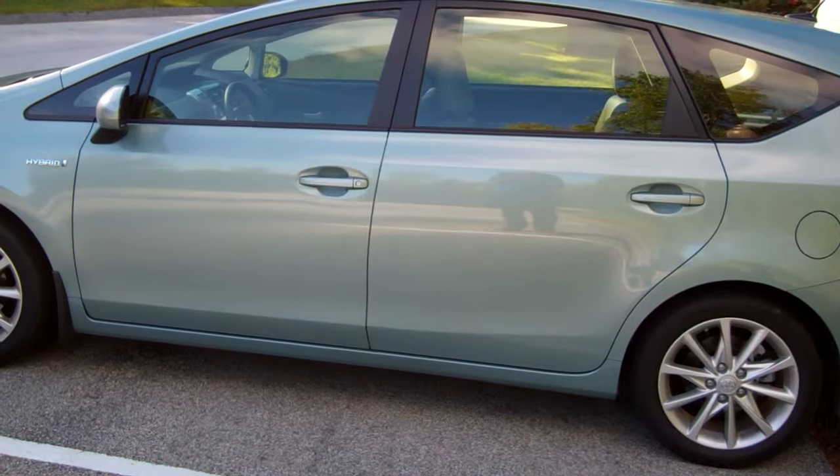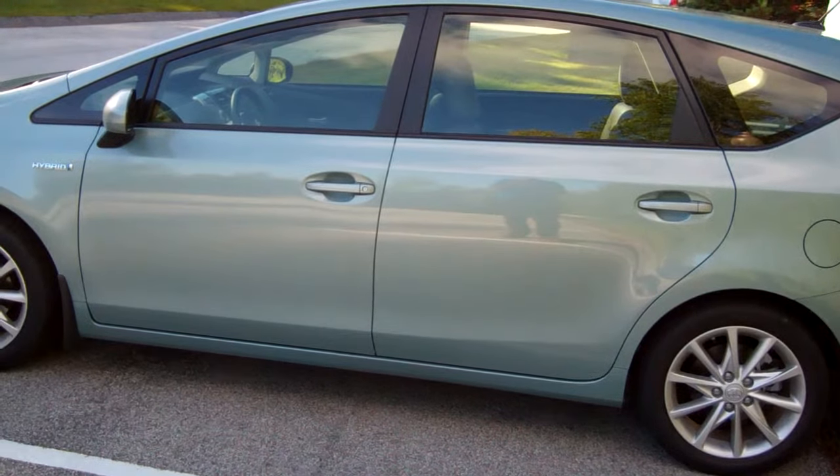Also, the inboard rear plastic cover does not fit because the seat rail is now lower than it used to be, so the plastic cover sits too high. I've decided to just leave mine off — you might want to try and trim it to fit. That's it from a happy Extend My Seat customer. Total time: about one hour.